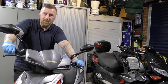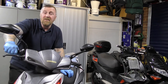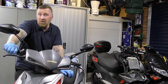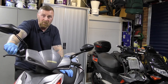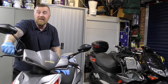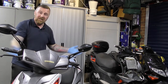The oil stops being a lubricant — it becomes like a coolant, it just doesn't work. When it comes to moped scooters, put in just a quality 10W40, 4T four-stroke oil — just an engine oil. Car oil is fine. So be careful when you use a motorbike-specific one. I've actually got 20 litres of motorbike 10W40, but it doesn't really matter as long as your clutch isn't in with your bike — that's the twist-and-go ones. For a motorbike, use some quality oil — whatever the spec says, whether it's 5W30 which a lot of sports bikes use, 15W50, whatever it's going to be. But for these mopeds, 10W40.